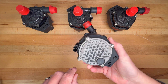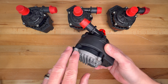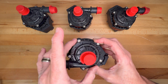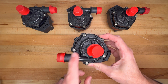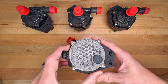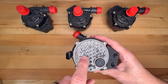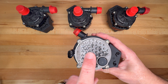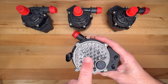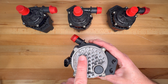I'm going to show you both sides of it. One thing we need to do is fix the printed circuit board, also known as a PCB, and that is going to be accessed by removing this side of the pump — removing these five T20 screws. There's an alternative way on the heat sink side, where you would remove four bolts, but the problem is that you need to de-solder the circuit board to remove it, and there is a thermal paste that connects the heat sink to the circuit board.